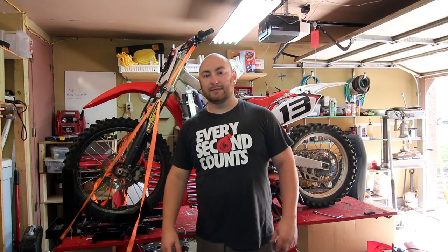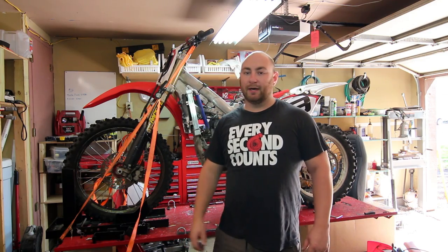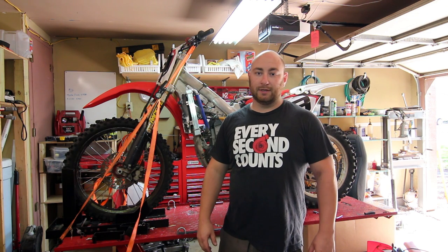But if it's just a valve, just a piston, or just a valve and a piston, then it's usually worth fixing because a bike like this in good condition is a $2,500 to $2,700 bike. My rule of thumb on projects like this is I'll get in there and take everything apart before I spend a dollar ordering anything. You want to make sure you have a good understanding of everything that's broken before you start spending money.